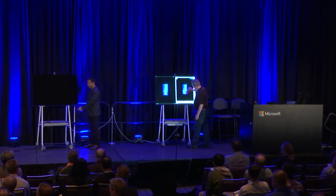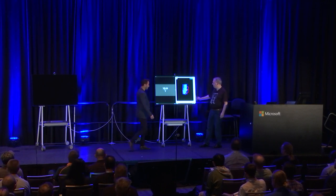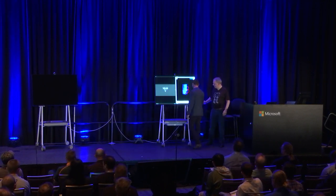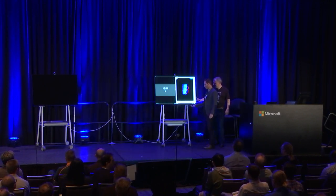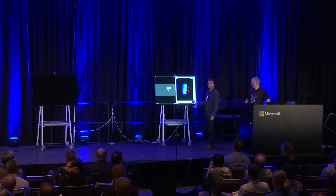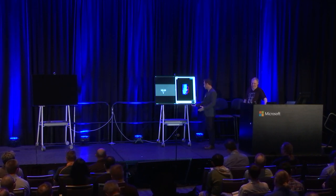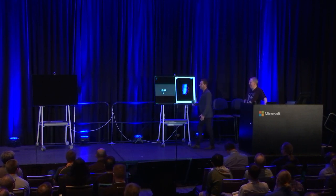The selection button is very important because not only does it change the selection, if you hold it for 4 seconds, you get an on-screen display. The on-screen display is the one that changes the brightness on your Surface Hubs. A lot of people are watching dim Surface Hubs over their lives because they don't know where that button is, okay? So make sure you know how to change the brightness of the Surface Hub.